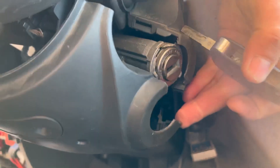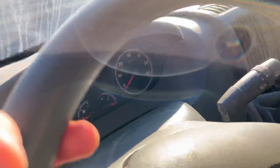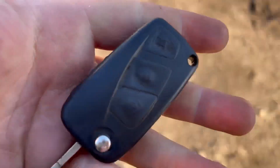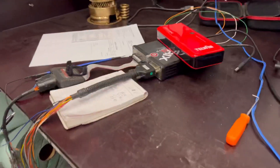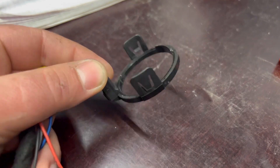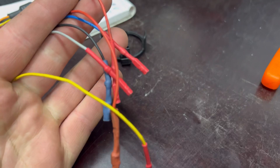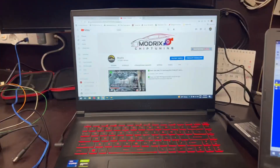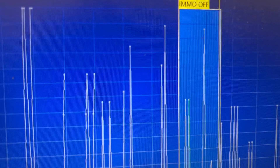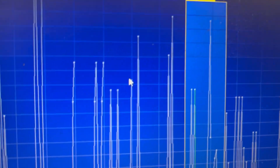Another thing — we have the steering from the Fiat. As you can see here we have the K-type and the IMMO coil. Let me show you where the IMMO coil is. You can see the K-type wiring, and there's the coil — that's what I wanted to show you. You don't need this coil anymore. It reads the IMMO data from the key — you don't need it at all. In bench mode it's connected by wires and you can do it pretty easily, no problem. Don't forget to click the subscribe button. This is how it looks on the software — we can remove the place which you need to do IMMO off.